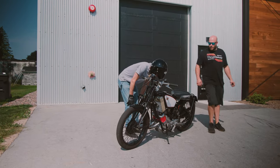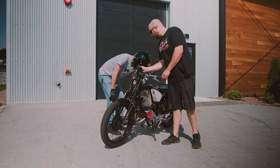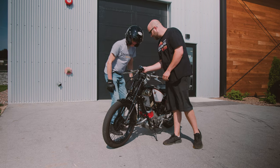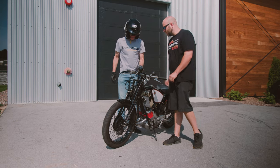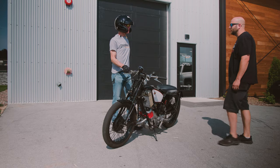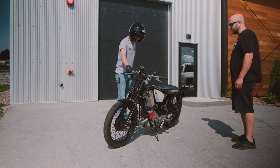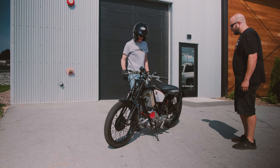I think we can get away with just choking the carb a little bit with this lever here. I can see it flowing through the sight glass — it'll build up in there. Choke is on. This all feels like a modern — modern British — at least 70s or 80s carbureted bikes. And then throw a leg over it.